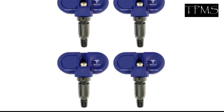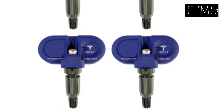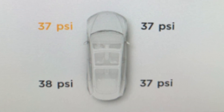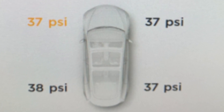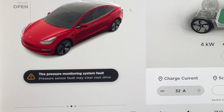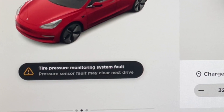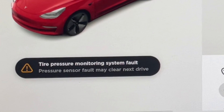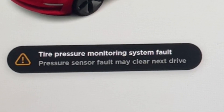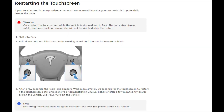There is one more step you might need to do regarding the TPMS on the wheels. TPMS, or Tire Pressure Monitoring System, is on all Tesla wheels and it's what tells your car what your tire pressure is at your dashboard screen. Immediately after a wheel change, you will see a warning on your screen noting a tire pressure monitoring system fault — this is normal and will go away after driving around for a bit. If the warning doesn't go away after a day, you may need to try resetting your TPMS by soft resetting your screen, which can be done by holding down both scroll wheel buttons at the same time. Wait for the screen to go black and wait for the system to restart, then try driving around again.